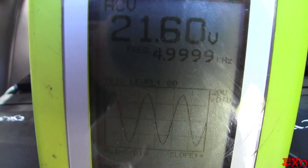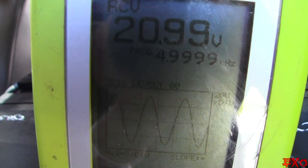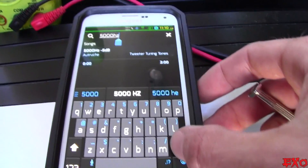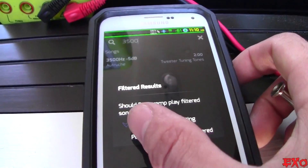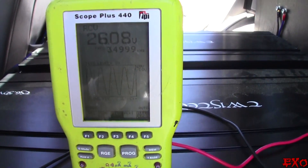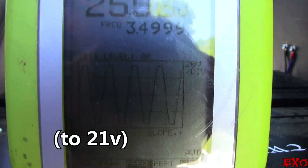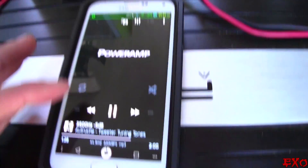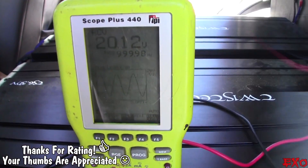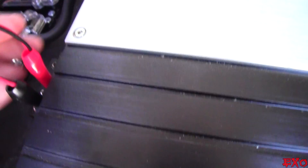You could only realistically increase by a volt. Your ear is pretty much on the money. Now that we know it's good on that one, we're going to switch the song to 3.5 kilohertz and make sure we're still pretty clean — this is pretty much where I have my tweeters start to taper off with their signal. Turn that up. I'm glad we checked this — I am definitely glad we checked this. So now we're just going to turn this down just a little bit. Now let's go to 1,000 hertz and make sure everything looks good. Looking good. Absolutely perfect.